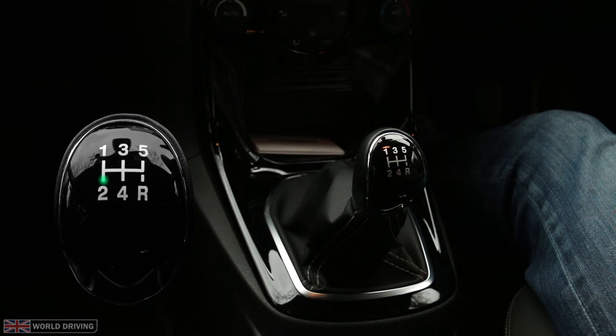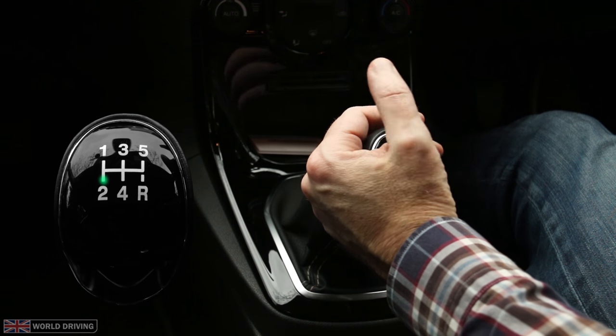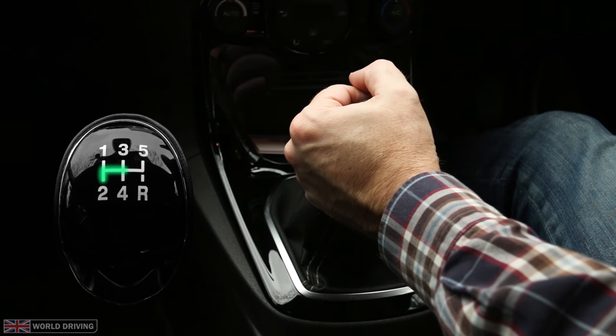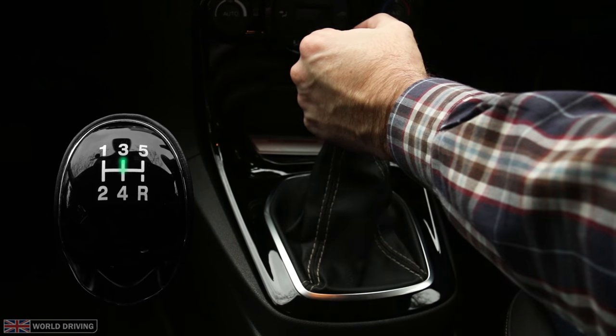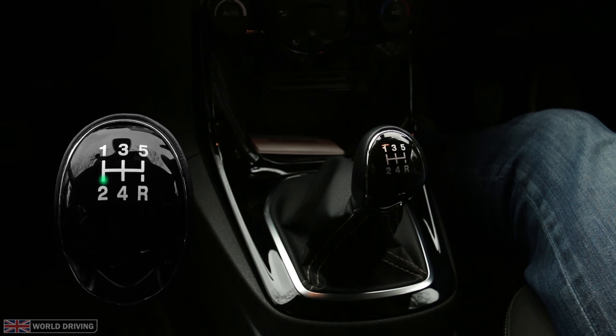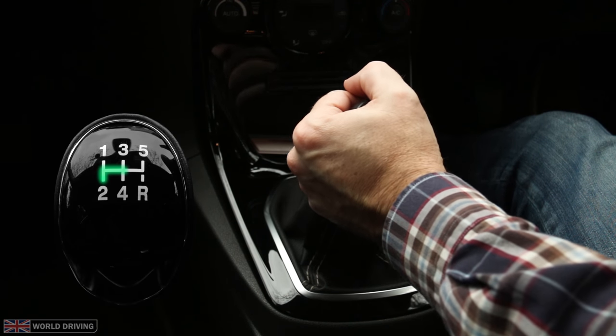I'm going to change up to third. Changing up to third, fourth and fifth, I'll move my hand so that my palm is facing myself and my thumb is pointing up. Don't forget that the gear lever is spring-loaded and wants to spring to the central neutral position just under third. Unlike first to second where I didn't want it to spring to the central position, this time I do and my hand position will allow this to happen. A little pressure forwards and it springs to neutral and then straight forward to third. A common mistake is to force it into third — this could lead you to changing into first or fifth by accident. Always remember to be gentle when changing gear and don't force it.